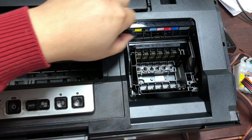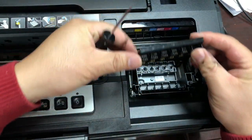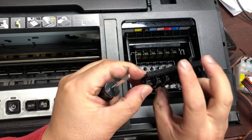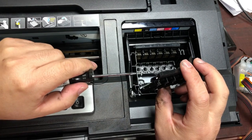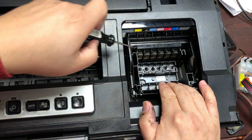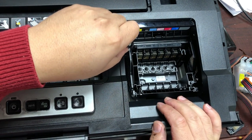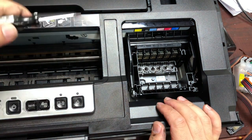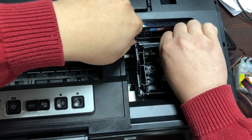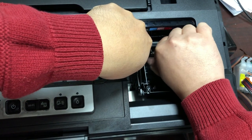The second step is to remove this board. You can see there's a tab here and a tab here. You don't need to figure out where the tab is because this thing slides on a wall. This is the notch holding the tab. Just slide your screwdriver in and twist it — it'll come off. Put your screwdriver towards the wall and then squeeze.